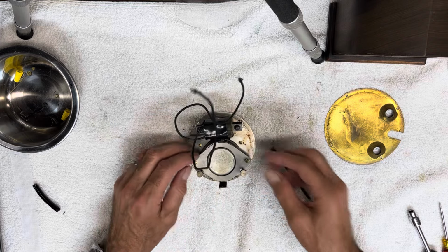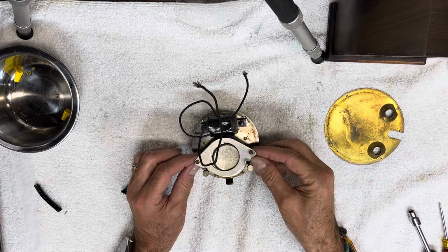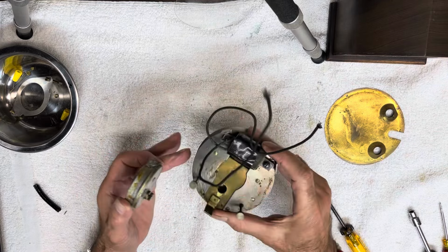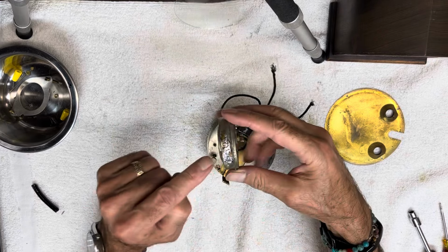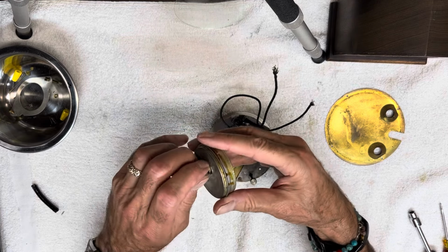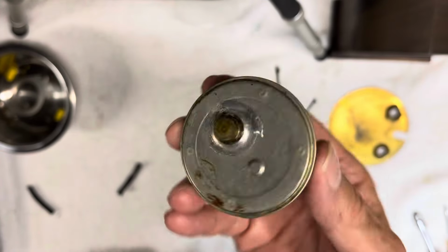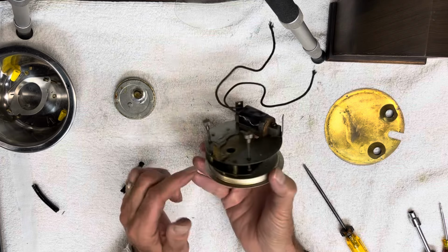Oh, it's like a spring holding it down. All right, this is definitely a Hammond mechanism, the whole thing. I recognize this. This is a classic Hammond rotor, the kind that has a plug covered by solder, which can be removed, and it lets you re-lubricate these. And this is probably very noisy, even notwithstanding the noise of the gears. I think you can hear it. So I'll open this up. I'll be cleaning and lubricating this, as well as hopefully everything that's in here.